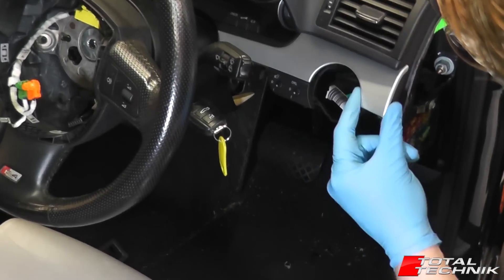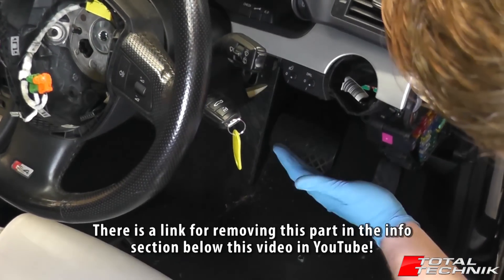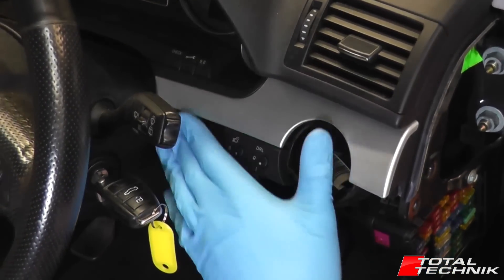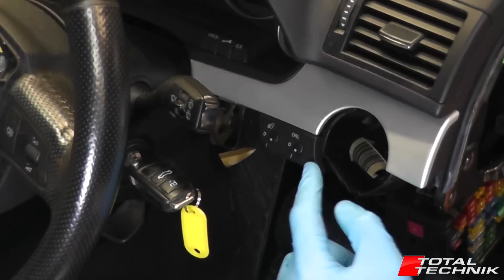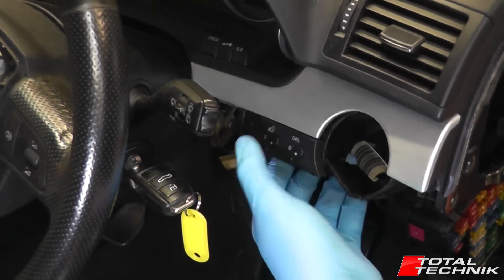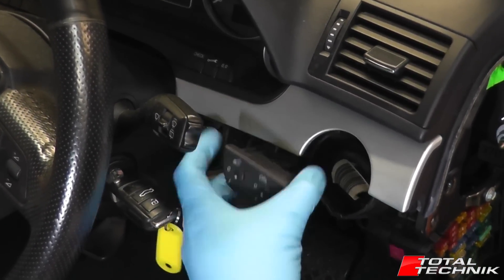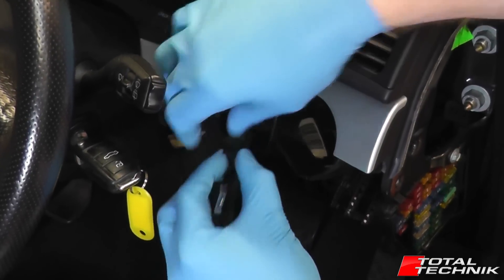The next stage of removing this piece of trim is we've just removed the lower dashboard section panel from underneath here, and that gives us the access we need to remove this. So we've removed the headlight switch and the lower dash panel. Next thing you've got to do is pop out the little control unit here. I've got the daytime running lights and the follow me home lights on this one — yours may have one of these controls, may have both, or may just be a blanking cap. Regardless of what type you've got, we've got to remove this. All you do is push it from the rear and you've got one electrical connection — remove that like so.